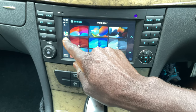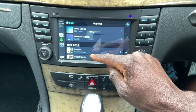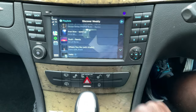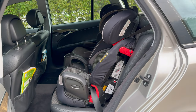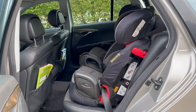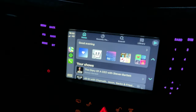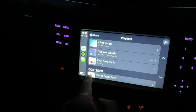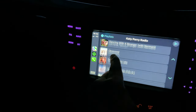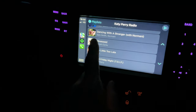Overall, that is all I have to say about upgrading from Audio 20 to an Android head unit. Should you do it in 2024? Absolutely yes. For me it cost £160 and it was totally worth it. It's very sophisticated — it receives a lot of information from the car through the CAN bus network, such as steering wheel angle, which you can see when you're reversing. It also receives information about which doors are open, whether the boot is open, as well as whether it's night or daytime, reflected in the night and day modes in Apple Maps. Overall, it's very good and I highly recommend one. If you have any questions please ask in the comment section, feel free to share your own experience, like and subscribe — thank you very much.